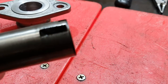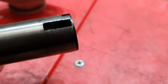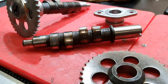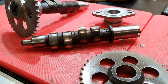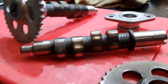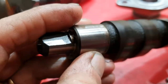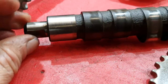If you have a look here, you can see the end of the cam is all mangled, and if I go in here you can also see that the keyway is all mangled. I don't really know what happened — at some point in its life this bike has suffered a trauma. The people who owned it before may have tried to fix it by putting a cam chain on without realizing the sprocket had come loose. It could have had a lockup — I've absolutely no idea and have never seen this happen before.